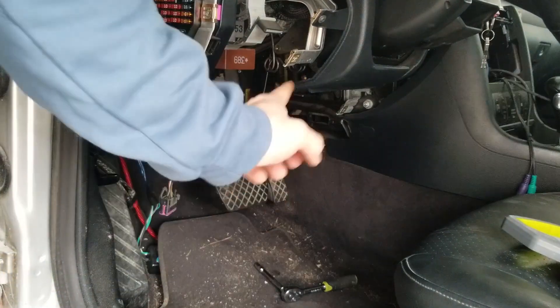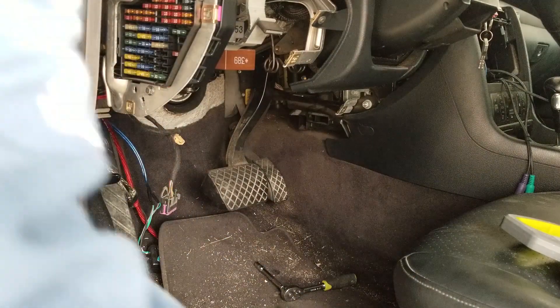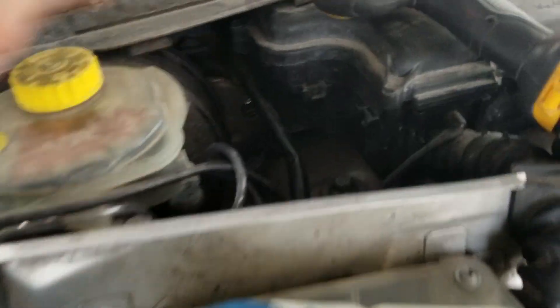With the kick panel off I've got a wire fed through there. I'm gonna try to grab it and pull it down into here. It's just above the steering column — you can see the light coming through right there. That's our new hole. We'll run the vacuum line this way, away from the steering column, and up into our new spot. You can see it runs up through here and then underneath there. We've got this grommet that it's already running through — I just put the grommet on the wire. We'll plug that in and we are done with this side.